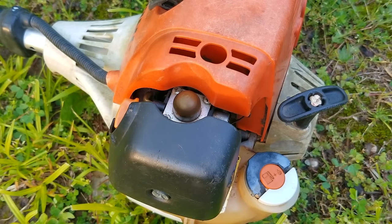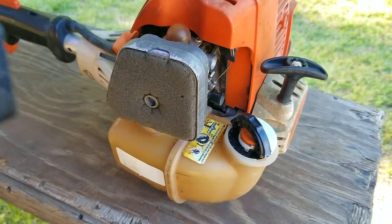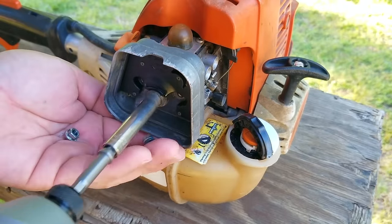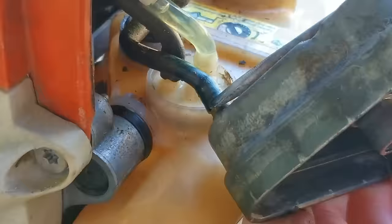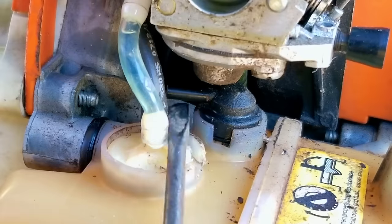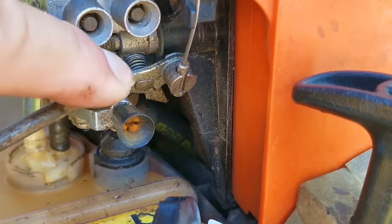Since it won't stay running no matter what changes we make, we've got to put it on the table for a full inspection, or at least enough to decide what to do. I don't normally work on this grade of equipment, and I had forgotten how different this machine is to the normal stuff I work on. The air filter base is surprisingly made out of metal, and there's also a breather tube that goes to the top of the fuel tank. While trying to take it off, I ended up taking the tube off the tank, which works just as well, although you do risk breaking the port it's connected to, so I would suggest taking it off the base instead.